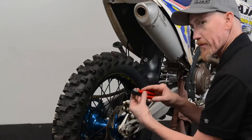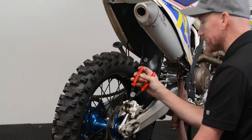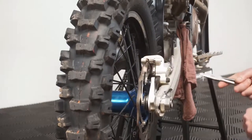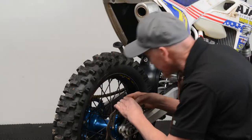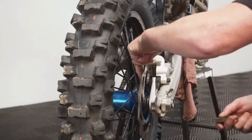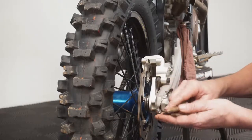I like to use a pair of snap ring pliers to put in between the pads — that way you don't have to get on the pad material or get against the disc, which keeps you from damaging anything that doesn't need to be damaged. We remove the pin and get the brake pad slide pin out of the way. Here are the brake pads out of this one — they're pretty much done. They've been fairly hot; you can tell by the discoloration of the pad surface material.